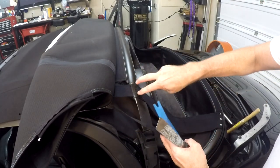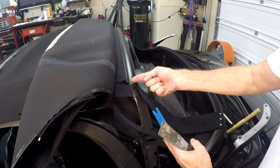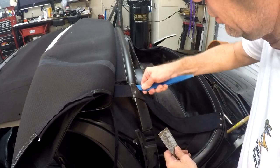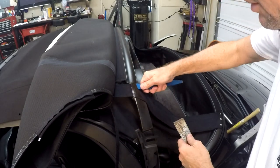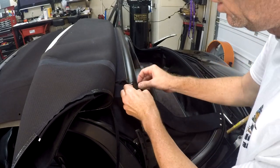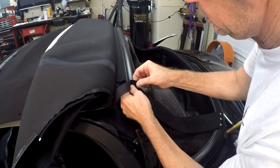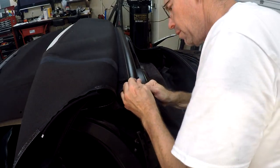On both sides we need to put this elastic strap and tuck it up under this clip. There are two push-in rivets on this plastic piece — we're going to pull up this side, put that in the hole, and tuck it right back. I've got to get on both sides of that plastic carefully so I don't tear it. Pry it up, she popped out — pull that up, put the strap on the rivet around the expansion piece, and back in the hole.